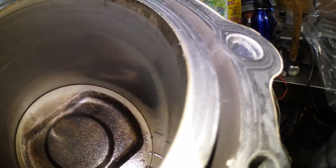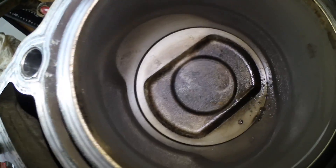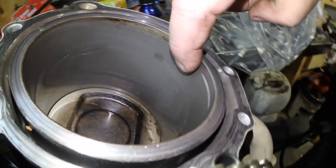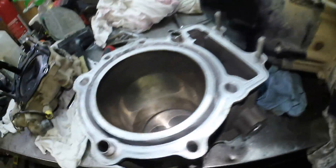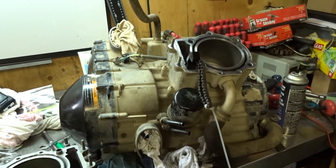Same with the cylinder — I just rotated the piston down from top dead center. The cylinder wall looks alright, but it doesn't look like there's any chrome finish left on it. Looking at the cylinder from the other engine we're going to use, it still has the cross hatching. We're not going to use this cylinder either. Basically what's going to happen — we're going to rebuild the head on the other one, rehone this cylinder from the old engine, and most likely use the old camshaft. There are no bearings in the head itself, it's just machined aluminum. We'll compare both camshafts and see which one is better, then get her back together.